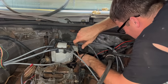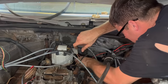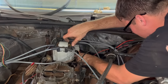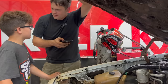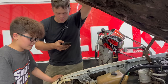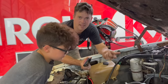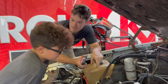Now I'm distracted — what engine is this? This thing came out with a 262 or 267, something like that. The block casting number is 3970010. Let's see what that is. It's a 1969-to-1979 model 350 four-bolt main! She thought it was a 305 — that's what her dad told her. But whoever had it before swapped in a four-bolt main 350, son. This has got more hog leg than we thought. We need to treat this thing with a little more respect.